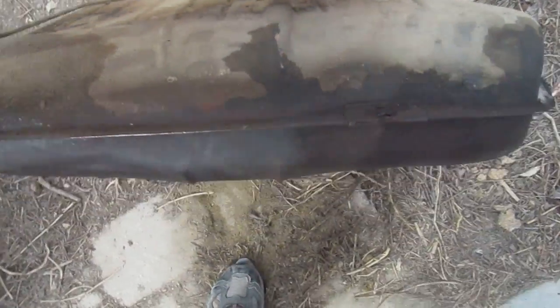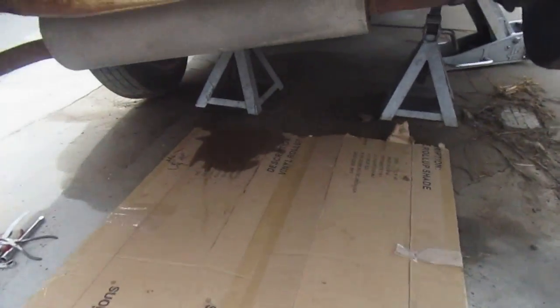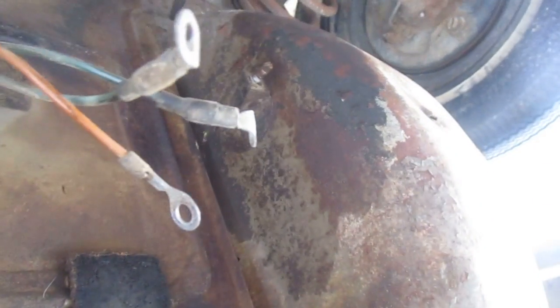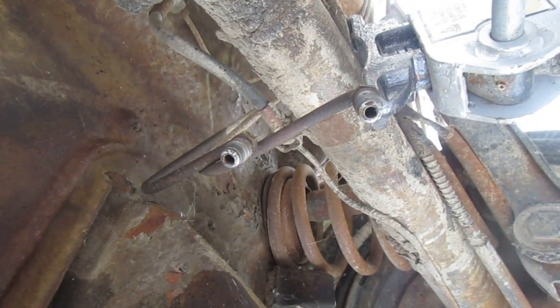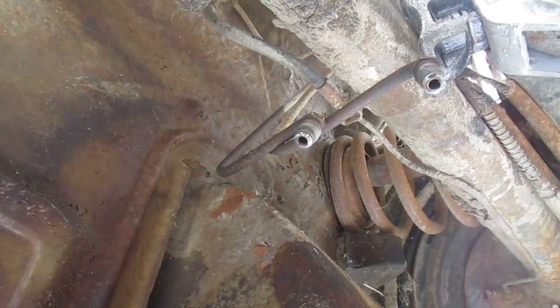It's just as easy to yank them and rebuild them. Looking underneath the car — here's our first bolt, there's our second bolt, there's our third bolt. You can see the harness for the fuel sending unit, and there are our fuel lines going up to the front of the engine. 14 millimeter, and if you're fortunate, these things come off simply.